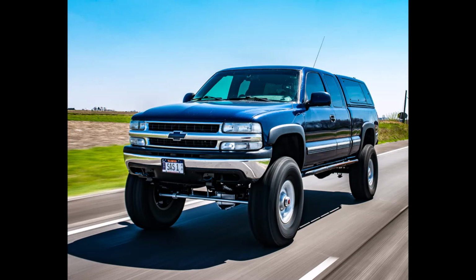That might come with... Sounds like you need a regear, too. Yes. 513s? So I have 513s in the garage. Oh, you already have them? Yep. Oh, cool. I got a good deal on some used ones. I might do new in the rear just since that one goes on the highway. On a 40-inch tire, how close are you to a stock ratio? 100% close. It's exact. You're dead on. I never reprogrammed my speedometer. No. When I had the 37s, I just did the math in my head. Right. And then I went to the 40s, and it's dead nuts. So it's like having a stock truck. Except that the tires weigh more. Yeah. And you have a lot more wind resistance. Yeah. So on the highway, the 456s are not ideal. So I think 513s will be right about perfect for highway driving. For 40s, right.